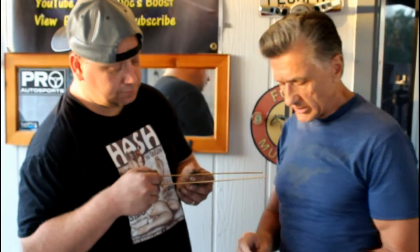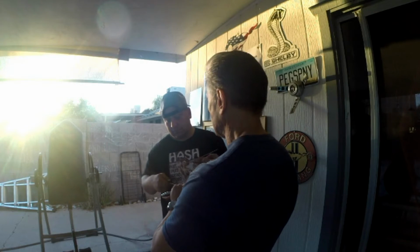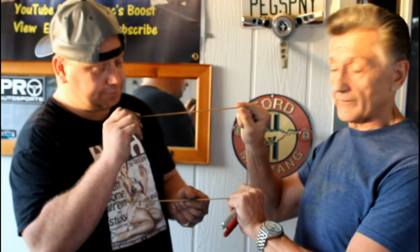Well, that looks like a good place to stop to let you know all about what hog ringing is, because that's what I'm in there digging for right now. The last scene that you just saw. And the thing about hog ring is that it actually connects two things together in an upholstery situation. What I'm looking at is a rod that's built into the seat back, molded into the cushions, another rod that's sewed right into the seat cover.